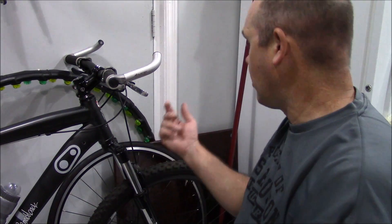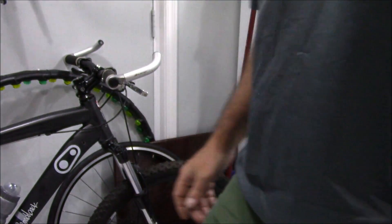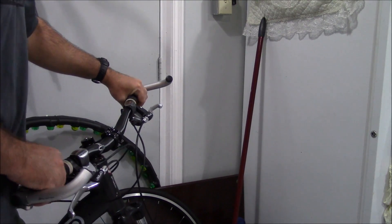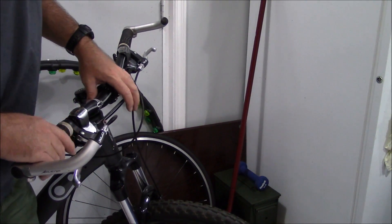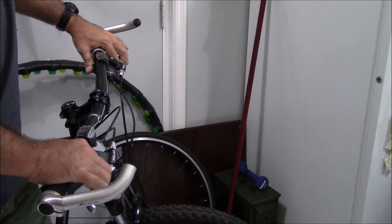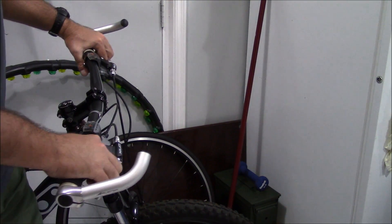Normally I like pressure applied right there when I pull the brake levers, and now it's about there — which is fine. If these were hydraulic brakes I wouldn't care because they use single finger brake levers. But with these longer BMX-style brake levers, I keep my hands all the way in and my index finger here for shifting. The longer brake levers have a little gap in the front that allows for that hand position.